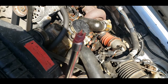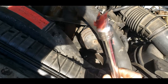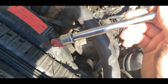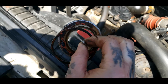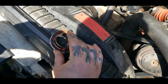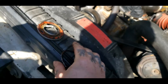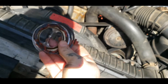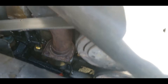Now, if you were replacing the whole gooseneck, you shouldn't have to use silicone, but I'm not replacing that. Tip for the back bolt: to keep it from falling out of your socket, put some grease inside the socket, set your bolt in, and it's good to install. As for the old thermostat — looking at the gasket and what's left — it's been hammered. The tabs are broken off. Somebody gutted this thermostat and just tried to seal it with the rubber O-ring. Maybe somebody thought it gives more power, but it actually does more damage than good. The motor doesn't run at optimal temperatures, so you don't get optimal performance.